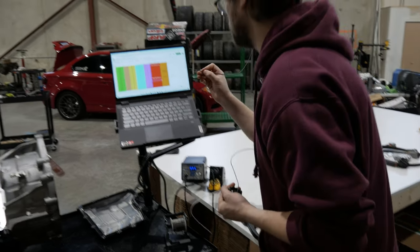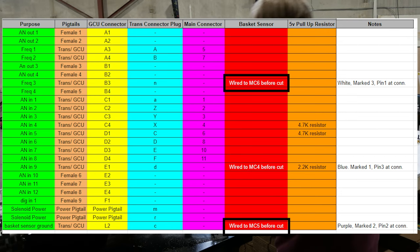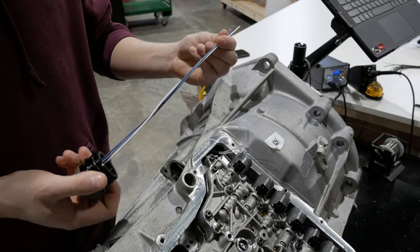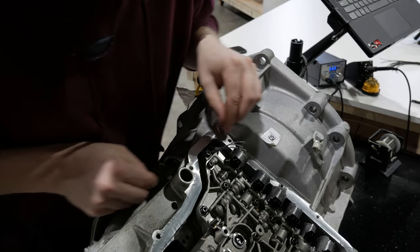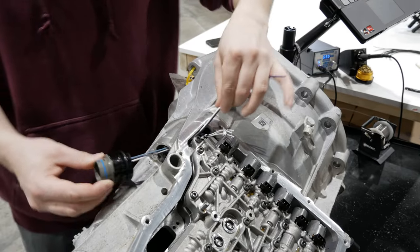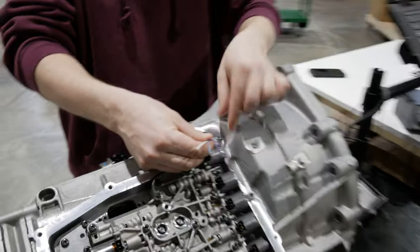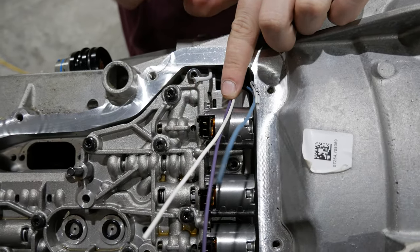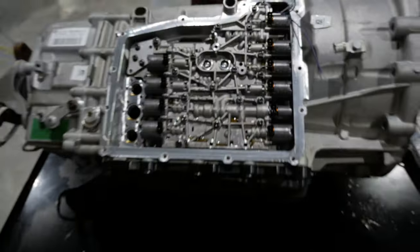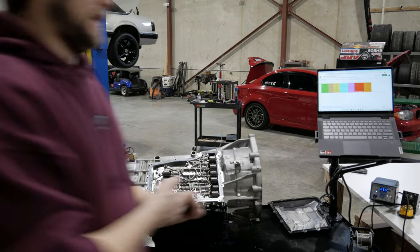Now that I have D installed, I'm going to go up to MC6, which is going to be N, which is going to be white, and pin 1 in the connector. So I'm just going to pin these out, slide them through, and then connect them. So we have our three wires — I'm just going to feed them through and leave about this much slack. Now what I'm going to do is cut the wires about even with the wires I left there, strip them, and then connect them. You want a little bit of slack so that when you're working with the rest of the harness, you have room to move around. We can always zip tie the looseness out of the way before we close it up.